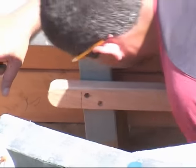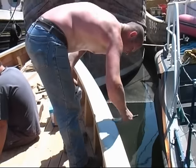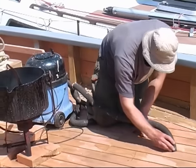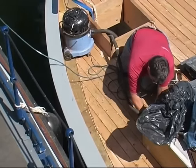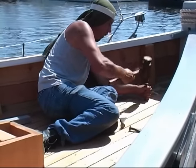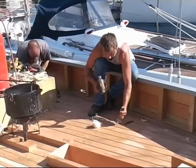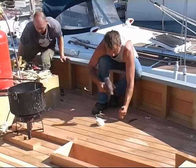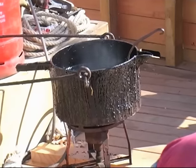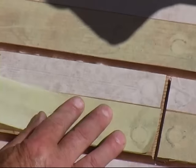Rob prepares a rope stringer rail while Barry undercoats the capping rail. John and Bob clean away any shavings and sawdust from the deck, while Andy caulks the deck seams. Hot pitch will be used on the seams, but first the deck planks are protected with masking tape.